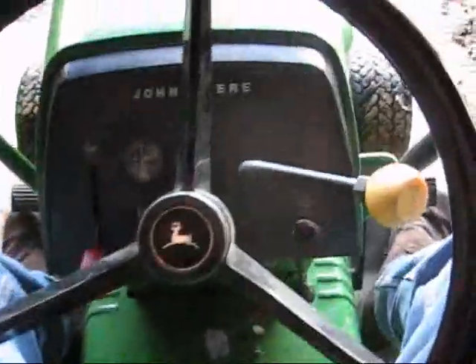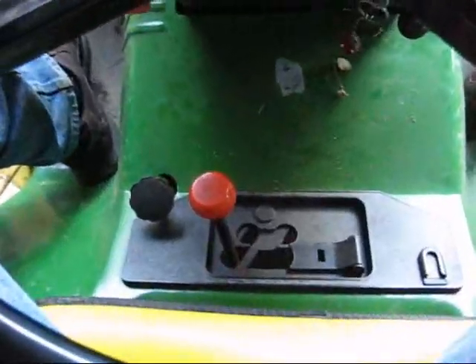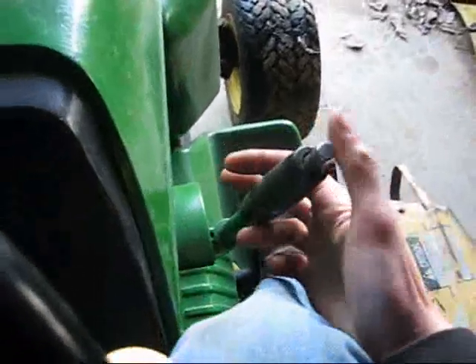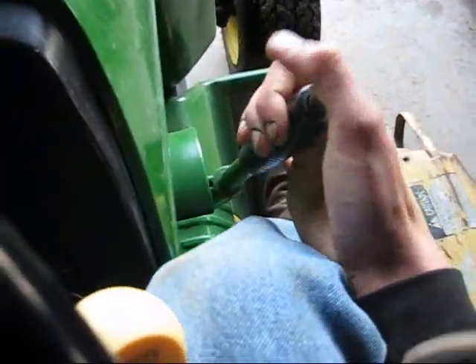I'm here in the suit town. I've been fooling around with the variator trying to get it adjusted a little bit more. As you can see, I've got it in fourth gear — actually, it's in reverse. Now it's in fourth. My foot is not on the clutch, and I just shifted it while the engine's running, just because I have the variator adjusted wrong. What's happening is the variator is acting like a hand clutch right now.